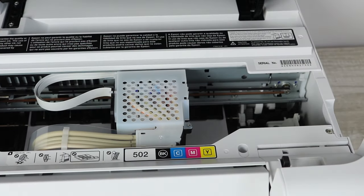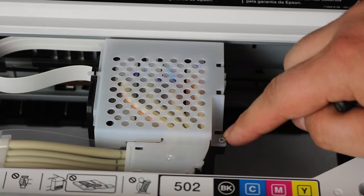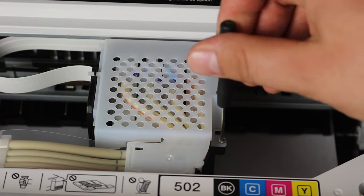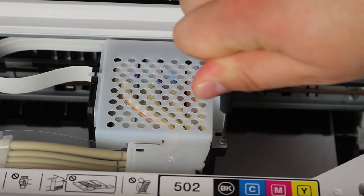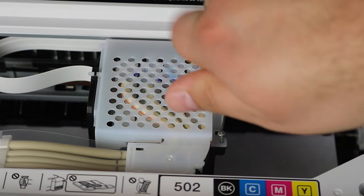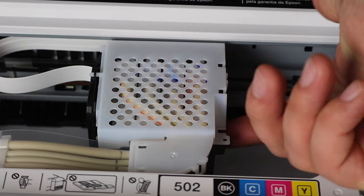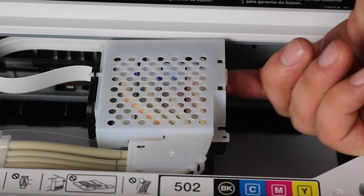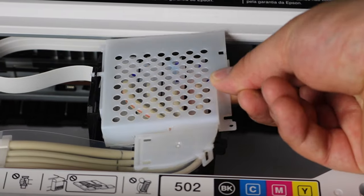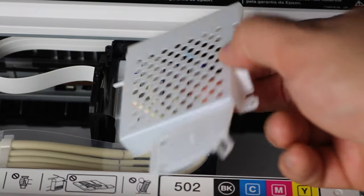As you can see, there's nothing that is damaged and there's nothing wrong with doing this process. Now this top piece, you are going to want to remove it with a very, very small Phillips head screwdriver. Again, I'll leave a link in the description below for one that is small enough for this screw. It's really just one screw — that's all you need this for. Then you're going to be unlatching — there's two latches, one there and then one back here — unlatching it and then pulling it out. That's the whole thing.